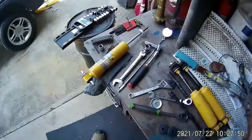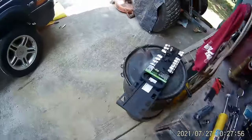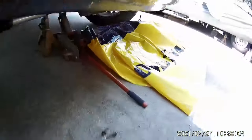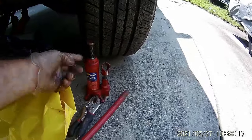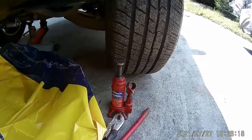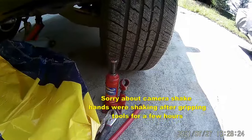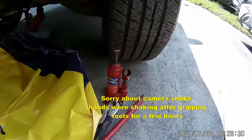I'm going to end this video now — I'm not going to film myself struggling to get these in. One more trick: these Bilsteins are so stiff, I wasn't able to push them in by hand. So what you have to do — that's why the bottle jack is here — you push the shock up into the truck, put the bottle jack underneath the shock, and you actually have to pump the shock up in there and get it to seat against the chassis. So put that under there, jack it up, then put the bolts in the chassis and you're good to go.